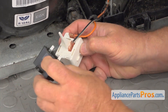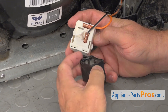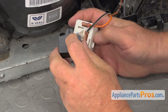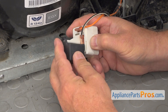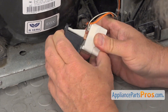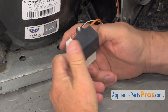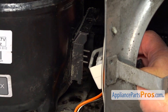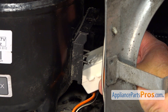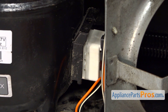The next step is to install this round capacitor. We've got these two contacts that go into these two little openings here, and we're going to install this opening over this tower — doing it at the same time and pressing it in. Now we're going to install the start device on the compressor terminals and push it on. Note that I'm disregarding the retainer spring because it won't fit on this new device.